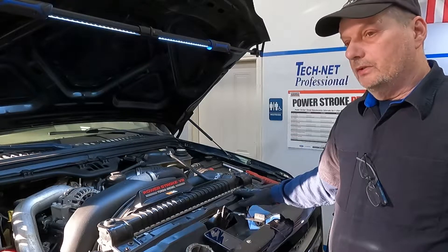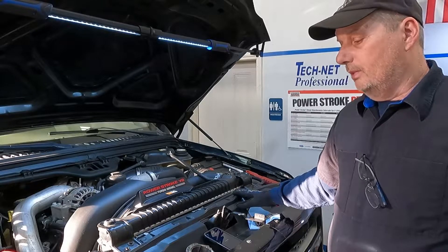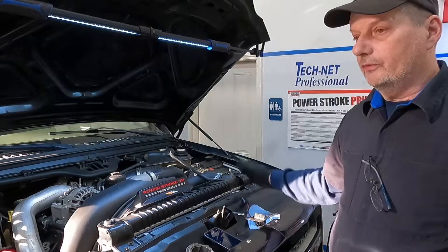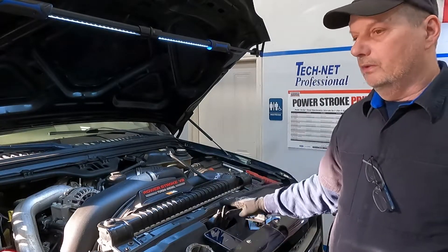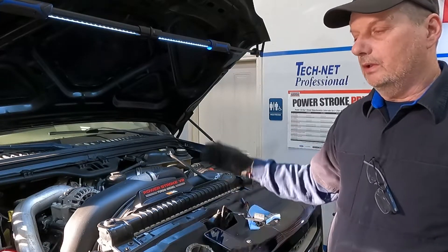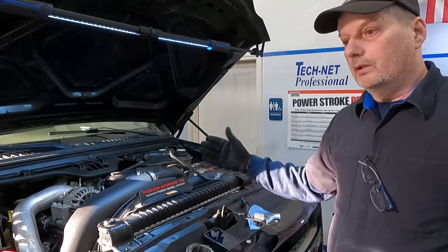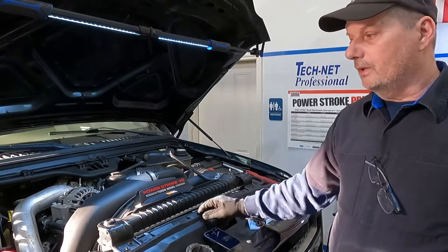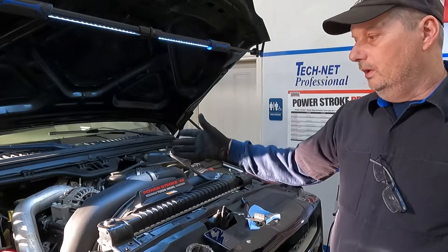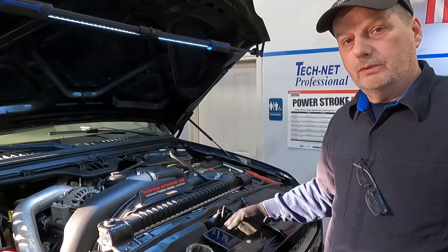It also had an extended crank when it's cold. So probably the first thing I'll do is air test it and see if I can hear a leak in there before I even tear it apart. That way, when I'm doing the oil cooler, I can make sure the snap-to-connect fitting on the high pressure oil pump isn't leaking, or the oil pump itself isn't leaking, or something wrong with the IPR — or we don't have a leak at an injector seal, a dummy plug, or a standpipe.